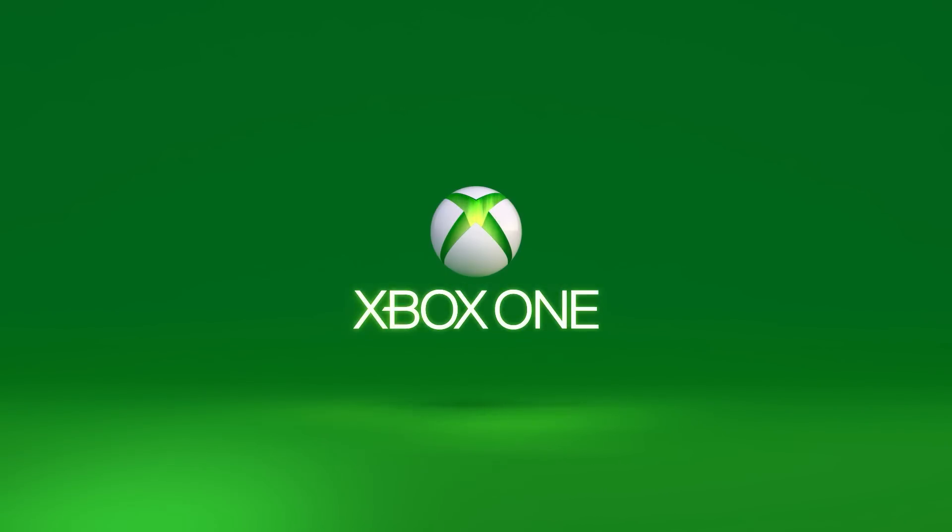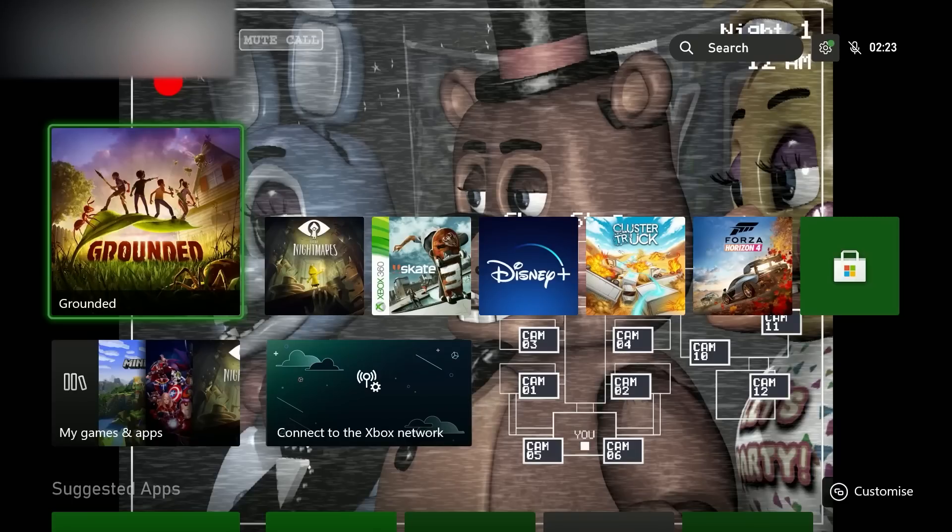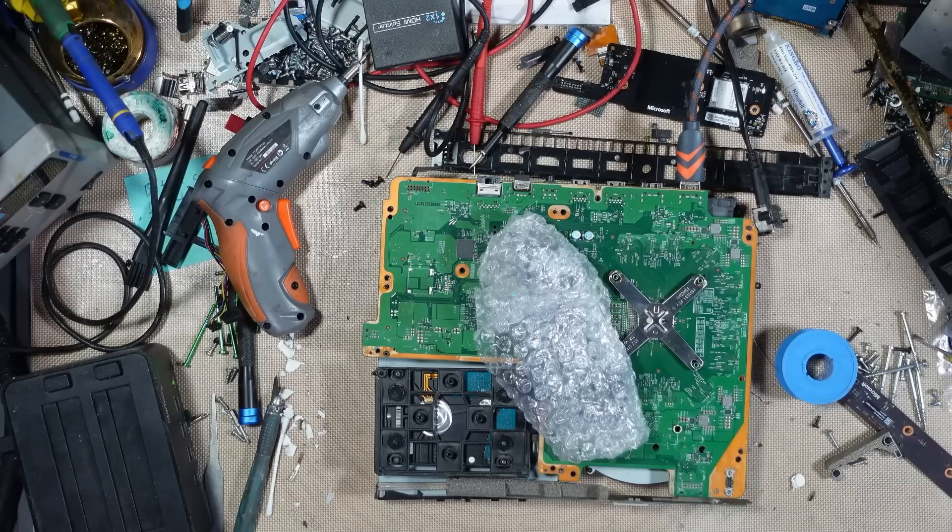See, when you move you're going to hire someone to clean your desk. Desk's always messy. Job done — console working, power supply no longer making weird noises. You were right — cap, 420 volts. It's always them caps. Console's working — happy days. I'm sure the customer will be too. Consolefix.shop is very kind for giving me these caps and allowing me to trial them, make sure they work before he sells them on his store.